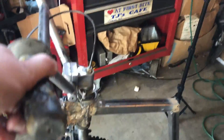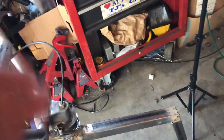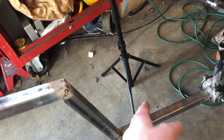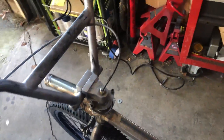We still got that air gap, but at the same time it should be okay for now. If I really wanted to, what I could do is at two cut points here, chop some off and then push this back, or just a little bit off here and then push that forward. In other news, it's really, really stable now — the steering doesn't do that tilt-steer thing. When you tilt it, the frame wanted to bend before, but it's got a really good rake now.